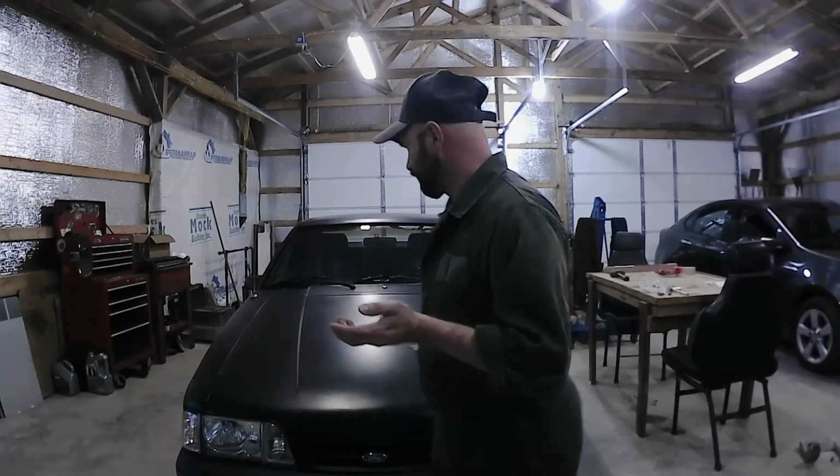Okay, so that's what I did for my Fox Body Mustang. Just some good maintenance and look over, especially since I've been taking it out to the autocross and putting stresses on the car that it actually wasn't designed for, right? So I didn't find anything major on the front end. It looked pretty good. Moving back to the rear end, my axles are moving a little bit, and they shouldn't really have that much movement in there. So that means I need to go in and replace those bearings.